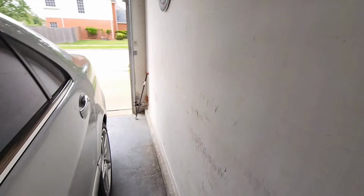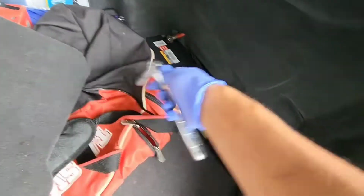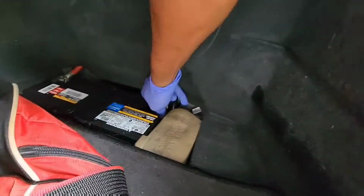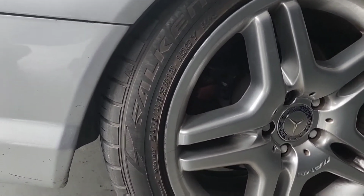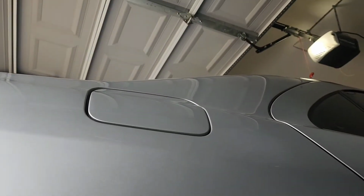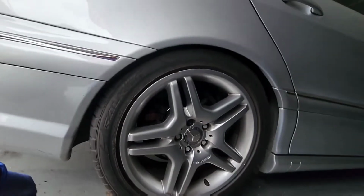All right, first step, definitely want to disconnect that battery. This is just to keep that air pump from going off when the strut is removed. So you gotta remove the tire, disconnect the sway bar bushing, disconnect the lower control arm, disconnect the brake caliper, and then there should be 3 bolts up top and an air hose. It's not a Lexus. But yeah. Let's get to it.